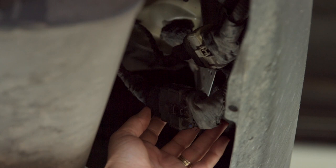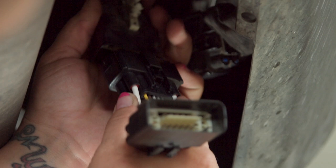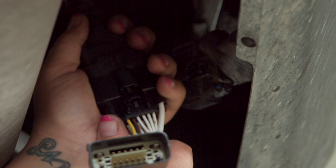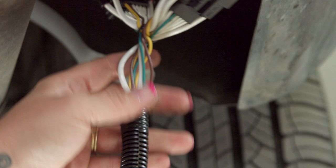What we're going to do is disconnect by just pushing the little pin and pulling it apart. Then we connect these two together — find which way it's going to take it, snap it until it clicks, and then snap it in until it doesn't want to come out anymore. And that is installing your T-connector. At this point the wiring is working because it's connected.